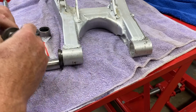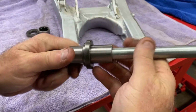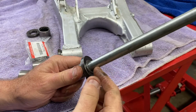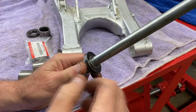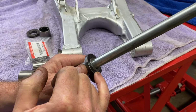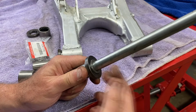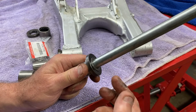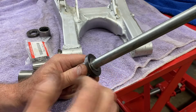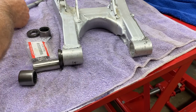So we'll essentially make the aluminum piece about this size. Here's one of the caps, of course, and pretend this is on the end, and this is where the pivot goes through. We will make one that is not bigger than the actual sleeve itself, because I think this sticks out a little bit when it's in there. But if it doesn't stick out, we have a little bit more latitude in the OD. Either way, we're just going to make it to capture, for sure, the face of the bushing between the two of them, the sleeve rather. And then I think that'll be fine.